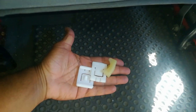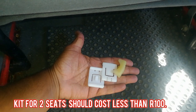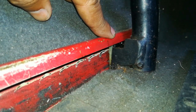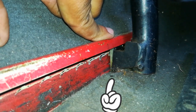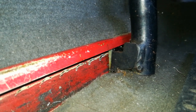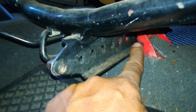In this video I'm going to show you how to solve that wobbly issue. All that needs to be done is just to replace three plastic components on the seats, because the ones on here now are probably worn out after being on the car for so many years. What causes the looseness or wobbliness of the seat is a plastic component behind this section of the seat which has worn out, and there's also a rubber-like component at the front of the seat.